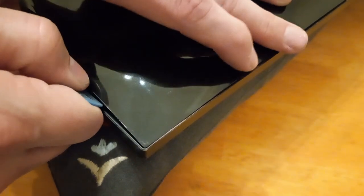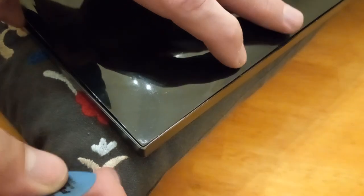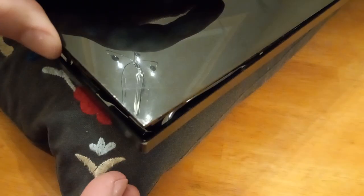Using your hand to pull the back and side apart from each other, you should be able to unzip it up to the top corner. It can be particularly difficult when you reach the corners. I like to use a second guitar pick wedged in to keep the snaps from re-closing. Then start on the top edge toward the corner until it pops off, then zip along the top edge.